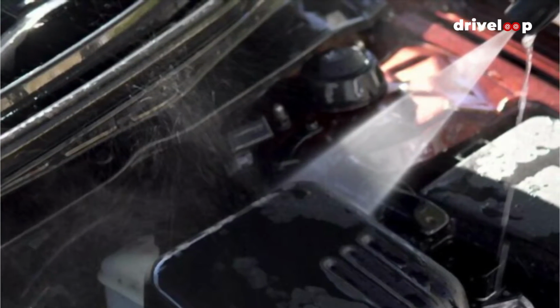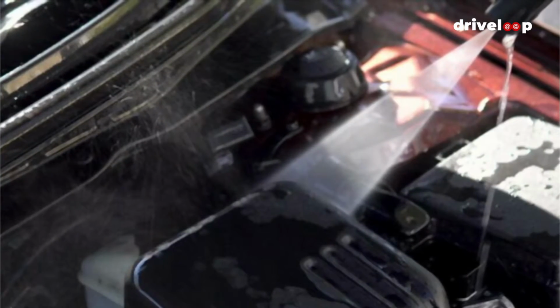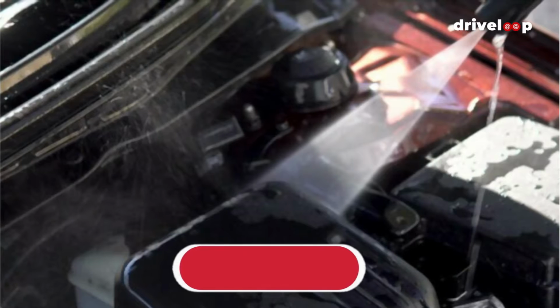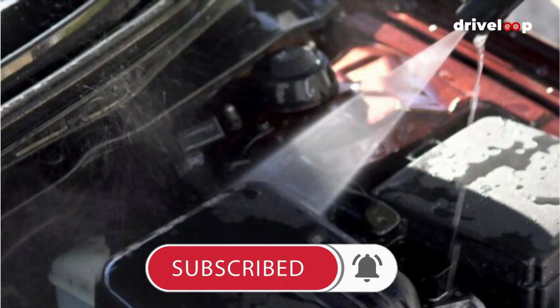If you have a power washer, you can use it on a light setting, but a standard hose will work as well. Or you can use the sprayer at the local DIY car wash. Rinse the entire compartment, working from back to front, washing away all degreaser. Try not to directly spray electrical components, and try to prevent spraying much water into areas that won't dry easily.